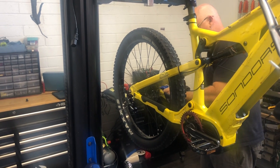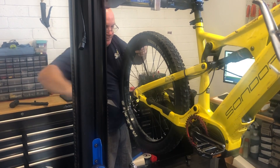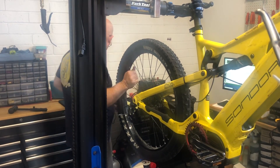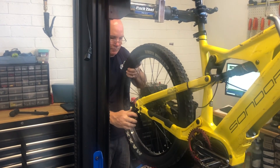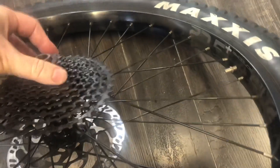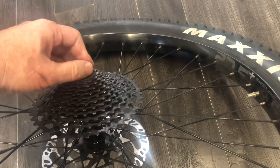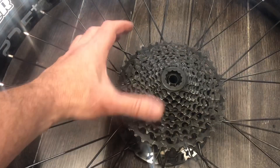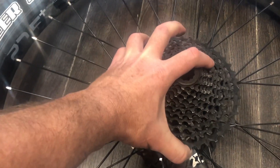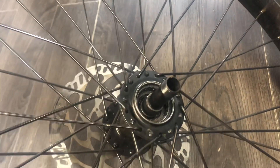Everybody knows a weak spot on this bike is the rear hub. Ray wasted no time — we knew the pawls were shot, we knew the bearings were shot. Ray's a pro bike mechanic, he doesn't mess around. He yanks on it and it finally comes free, then he gave it to me. The free wheel was like finger tight. Here's me unscrewing it, trying to stay out of Ray's way. I pull off the free wheel — or I'll call it the cassette — and you could see this 3-pawl system and this weak-ass spring. It's broken and it's shot. We just wanted to see where it failed.